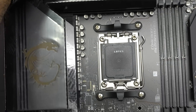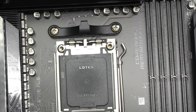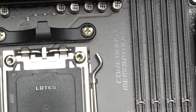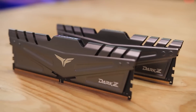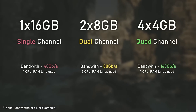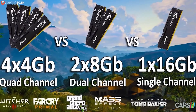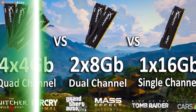Next to the CPU, you can see the board has 4 DIMM slots supporting DDR5 with speeds of more than 6666 MHz and a maximum capacity of 128GB. Of course, it's not recommended to fully populate all 4 slots at 128GB at those speeds — not that the board can't support it, but it has more to do with memory controller limitations than the board itself.